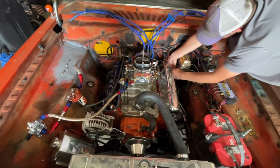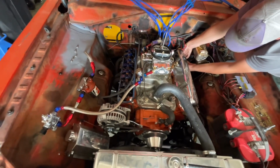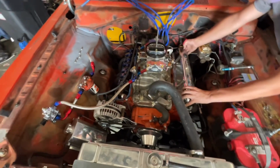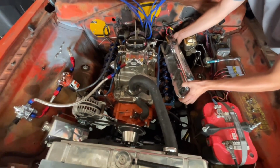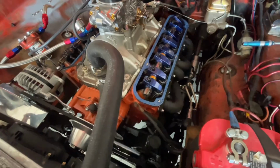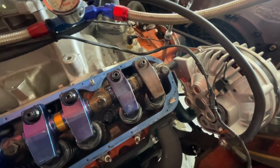That's crazy, because I know those were torqued. Hopefully it didn't do any other damage. That would make sense why it started missing first, and it sounded like there was a valve not opening. Yeah, it smelled when you took it off. So this side looks all good. I'll check all the rockers, make sure they're tight, but yeah, I'm going to say that's the issue right there.